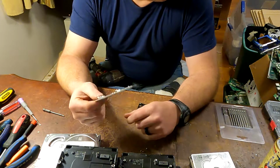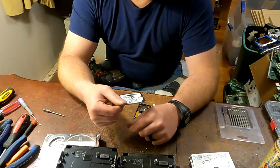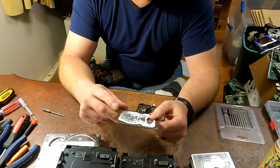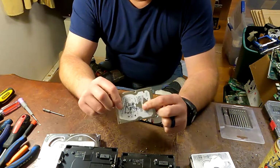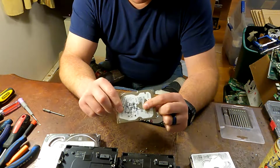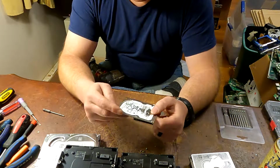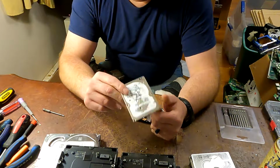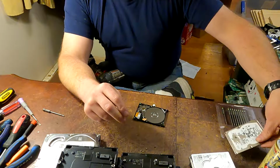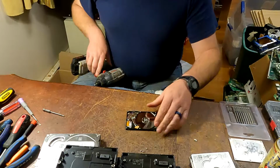So that's when your magnet comes in handy. I may not have one sitting around here. If your magnet sticks to it, then it goes to the shred pile. If it doesn't stick to it, 9 times out of 10, it's stainless steel. You get paid higher for stainless steel, so keep them separate. So that gets you to the inside.